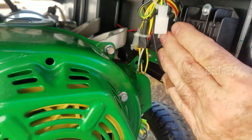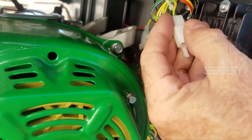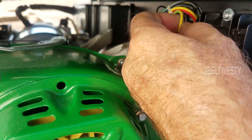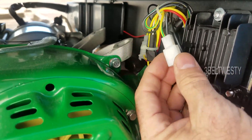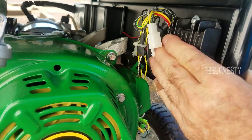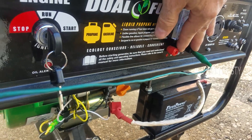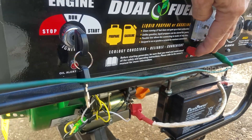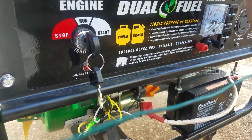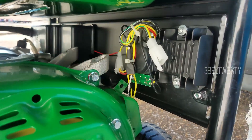This module here — I took it off. It's got five wires on it and I'm not sure what it is. I think this connector is just for testing when they build the unit. The white-green wire, when I first tried this before I started up, was connected to ground, but after goofing around it was open — so I think this has got some logic in it. It's got a little bit of heat output. I believe this might be the regulator, and again it's not going to regulate until you get a little bit of load on there.